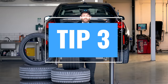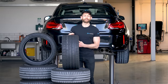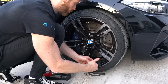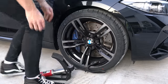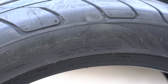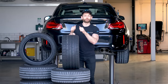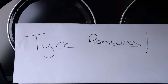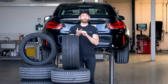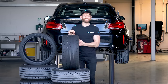Tip 3: over-inflate your tyres. As we can't get the car in the air, we're going to have to over-inflate the tyres to give them more support. Usually around 15 PSI or 1 bar over is a good amount, but make sure you don't exceed the maximum allowed tyre pressure, which is noted on every tyre sidewall. Write a post-it note and stick it on your dashboard so you don't forget. Over-inflated tyres might be good for economy, but they're bad for grip, comfort, wet performance, and wear — you wear the centre part of the tyre out much quicker, which can lead to early failures.